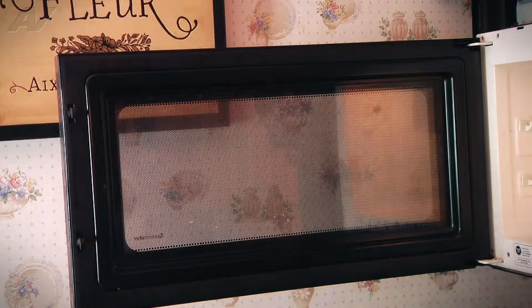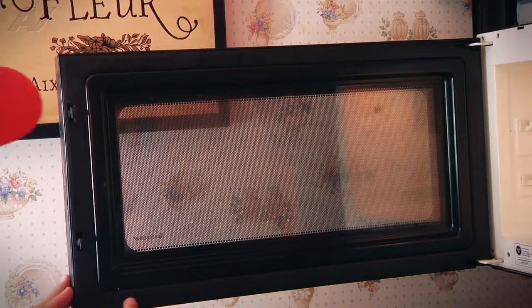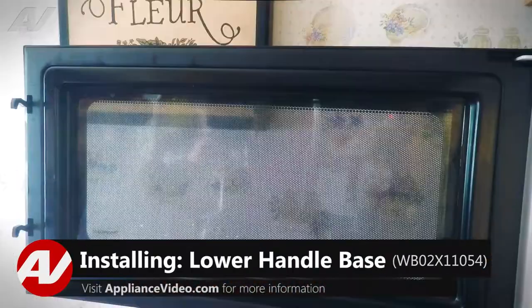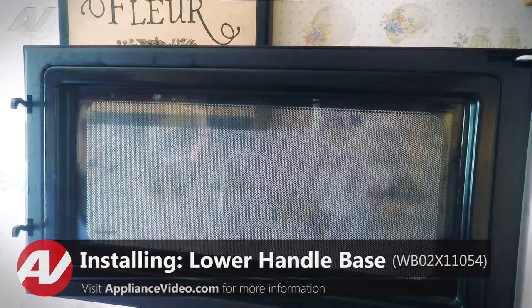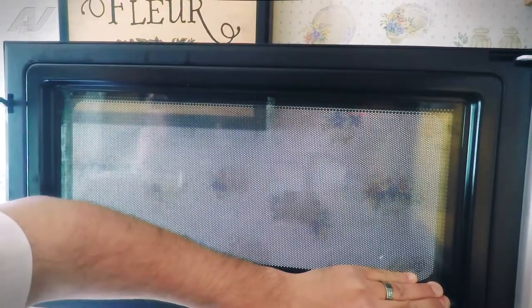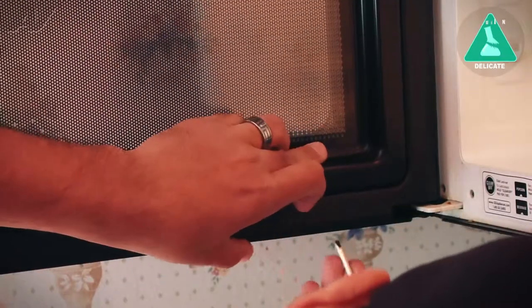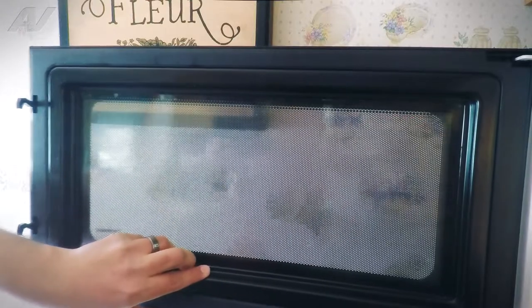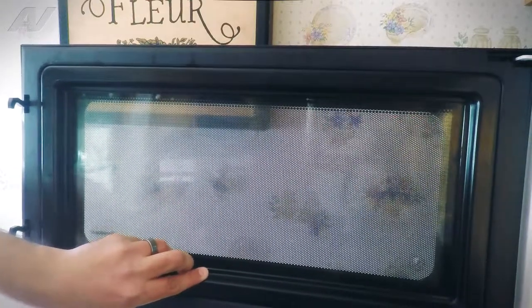Now that the door's been opened, we can start removing the inner door trim here, and we're going to remove it along the perimeter of the actual glass frame. To do so, using a small flat blade screwdriver, we're going to begin wherever we can get in and just pry on the door gently, because there are little clips that some of them will break off when taking off the door liner. It's just something that you cannot avoid, but you want to be careful so we don't break off many of them. And we're just going to do this all the way around the unit.